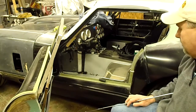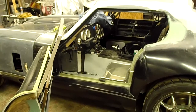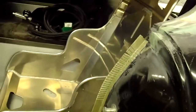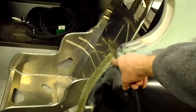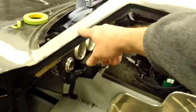You can see, let me get behind the camera. Take it off this tripod. You can see right here where I had to cut slots in it to allow it to be flexed, and I also cut slots in the face of it. This allowed me to flex it around and get it how I want it. At this point right here, I'm going to have a tempered glass back window that will probably be glued in place with urethane glue, so that the seal can continue. This is kind of hard to do with just one guy. Anyway, the seal will come up and hook on here and then come around.